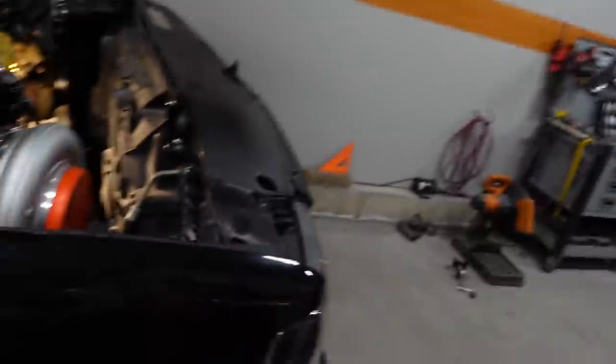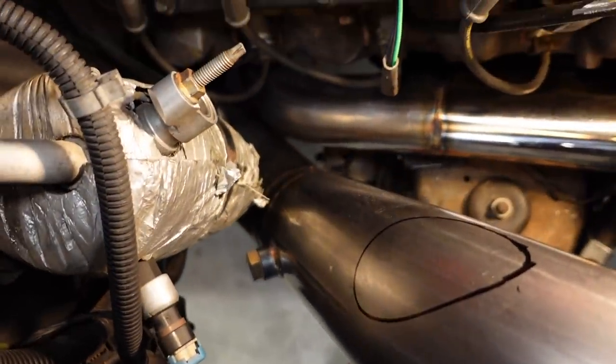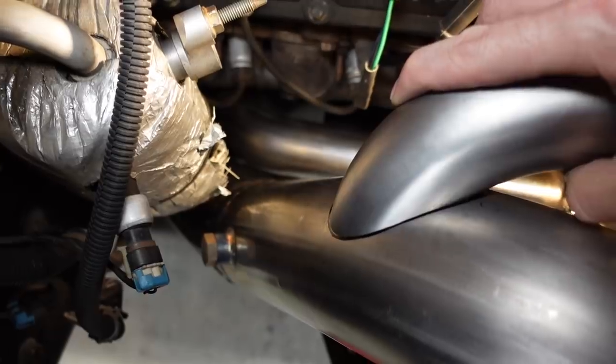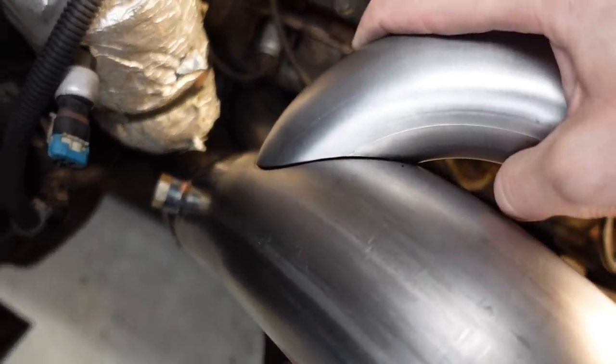The reason why this transition has such a weird, funky angle on it is because it's what I would consider a double compound bend — you've got the curve leading into the curve of the downpipe. If I can get this lined up in exactly the right spot, you can see how well that thing's going to fit together. It was definitely worth the effort because it's going to TIG weld together perfectly. I can't do any welding just yet because I'm waiting on a bellows that goes in this pipe to allow for a little bit of thermal expansion and movement. When it shows up I'll weld the bellows to the V-band, trim this off, weld this to the other end of the bellows, mark the final position of the hole in the downpipe, cut the hole, tack weld it, bring it out on the bench and finish weld it. Then I can connect the downpipe to the cat-back, which will finish up the exhaust for good.